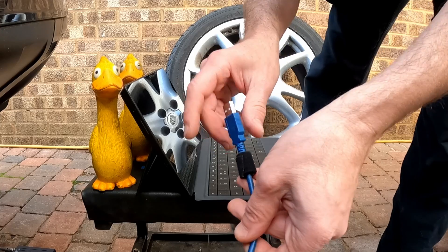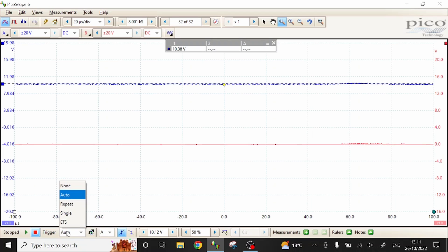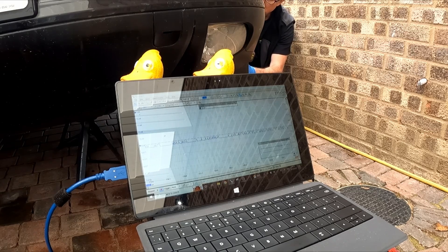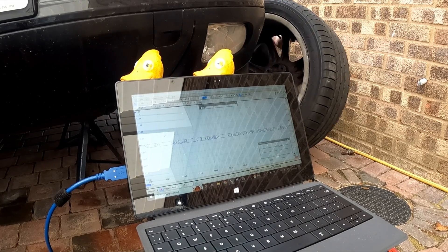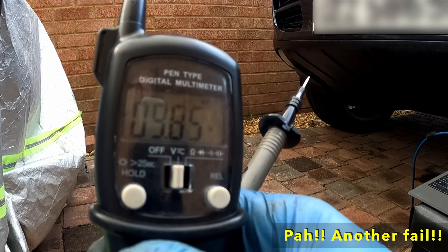So what I'm going to do is take a trace from the front left, which I know is not causing a problem — no codes or anything reported on that one — and do a comparison. I couldn't get any sort of signal out of the near-side sensor, yet I know it works. I figured I'd best take the wheel off again and check all my connections. Everything was okay, but the reason I can't get a reading is that my battery is really quite low — 9.8 volts is well below what it needs to be. So I've pretty much run out of time on this today.